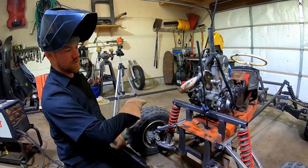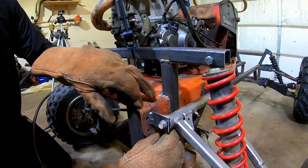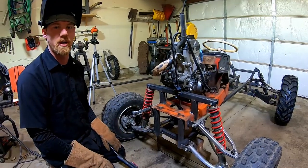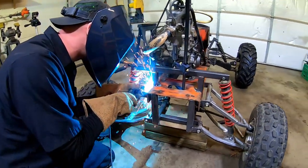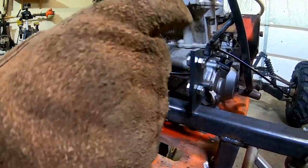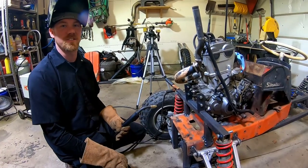We got this whole structure built, put the uprights in there, and we have everything set. We're going to weld this in so it'll tie everything together. We ran the pieces past the radius of the frame here to give it a little more strength, and then we'll get everything welded up and it'll be sitting on its own weight. Kurt went ahead and made up the tabs for the forward-most motor mount — cut them, drilled them — so that's all set to go. Once I get this welded in, this 450 engine will be permanently mounted into Not So Simplicity.